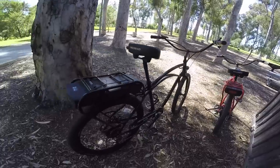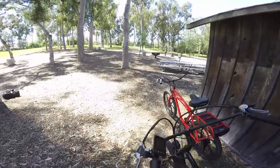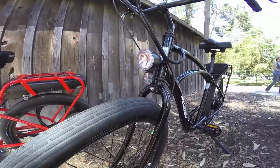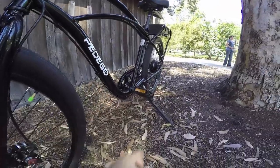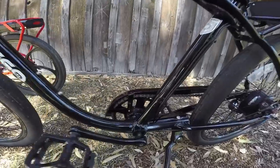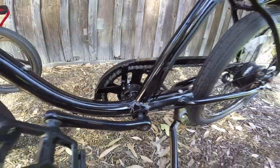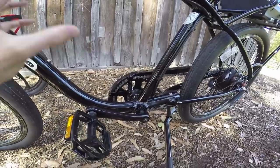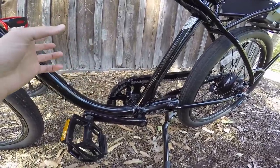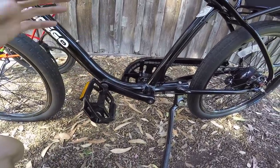I love that the Interceptor comes with lights — there's one on the back and one on the front, attached at the fork so you can aim it, with a built-in reflector. Same with the pedals. And now they're using a 12-magnet cadence sensor — this plastic disc with little magnetic dots. Having 12 magnets makes it more refined: pedal assist starts a little quicker and stops quicker when you discontinue pedaling.